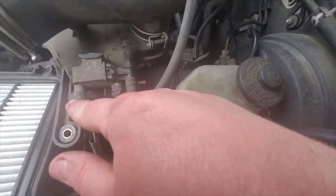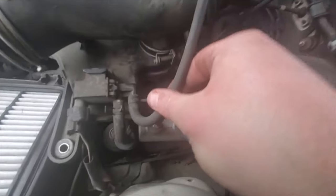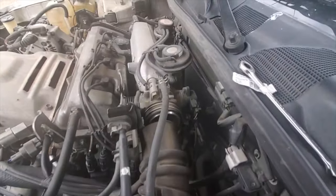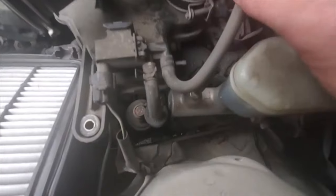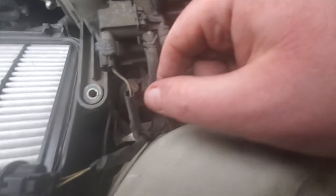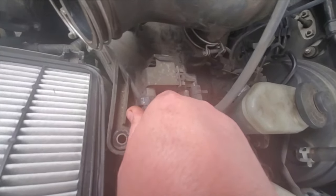You've got to remove this electrical connector, this hose, and this hose. This hose down here, the one with the bend, goes from here all the way up to your throttle body. And this hose with the little fat end down there by the brake booster, brake master cylinder — that goes right there to parts unknown. And you've got to remove this electrical connector as well.